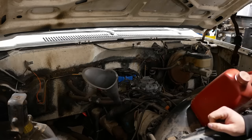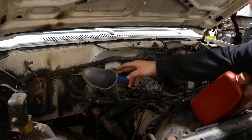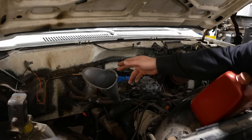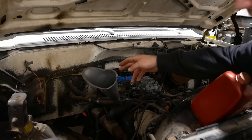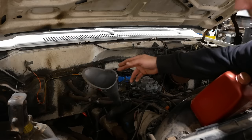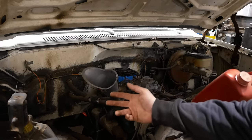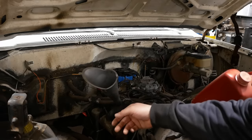So I don't know. So here'd be my advice. If you have a high lift camshaft or some stronger valve springs or something for a performance application, buy a performance application oil. You know, buy an AMS oil or whatever that's designed with the higher zinc content. Don't add a zinc additive to some generic oil, because you don't know how that zinc additive is going to interact with the other additives that are already in that oil. Maybe Project Farm or somebody has a video that addresses that. I don't know.